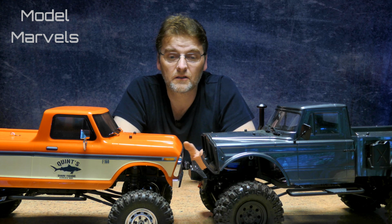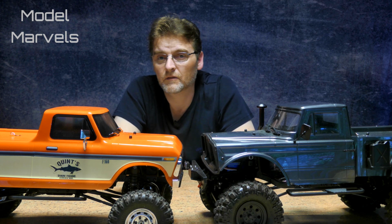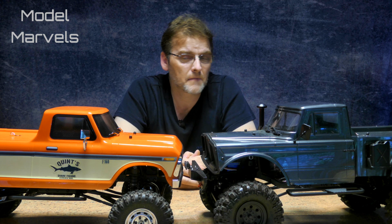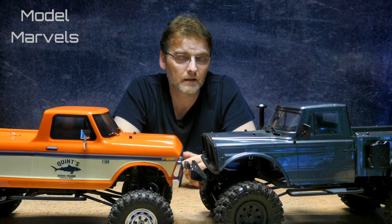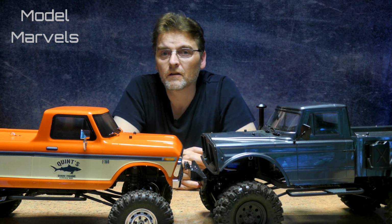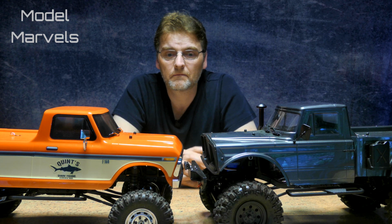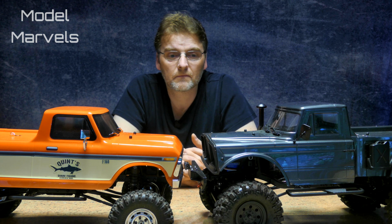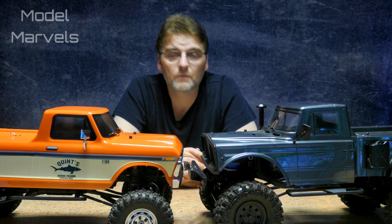Yeah, and as I said, they both perform well now, and we are very happy with it. So to change, just to recap quickly, just the front CV shafts is all you need to change over, and the complete rear axle, and possibly longer upper links on this one. So thanks for watching. Here's footage of both of them running pretty much over the same sort of ground, just as a comparison.